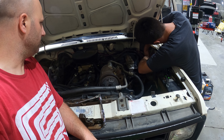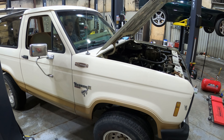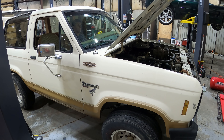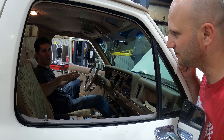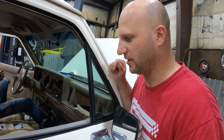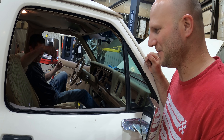This thing is set up. Hit that key — if it doesn't work I take no responsibility. It looks like it's got a little bit of an issue with the priming squirt. The multiplier probably defaults to a V8 or something — way too much fuel. When he put it all the way down it stopped flooding and it started. So it cranks and cranks and cranks. If you get it to start you've got to floorboard the engine, which kills the injectors momentarily. Flooring it kills the injectors and that's the only way to get it to start currently, but once it started, give it a rev.